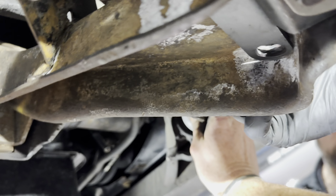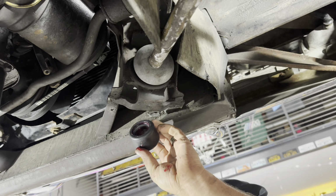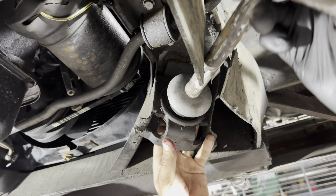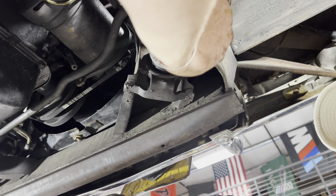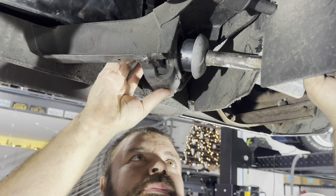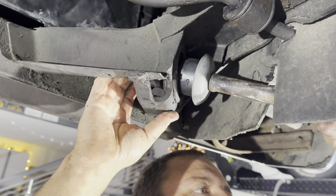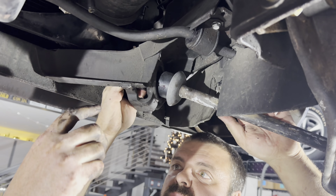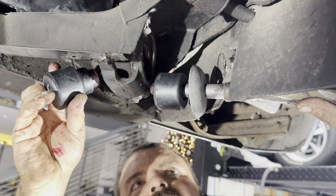This bushing is supposed to go through, right? It lines up, it just needs to get on there. This thing will pull it through? Yeah. Now this goes on here. It's straight though. You got to shove that through. Keep pushing, you got to push pretty hard. You've got to get the bushing through, and then get this on the end of it. Do we need a mallet or something? You do need to draw it. Should we use the nut and a big washer on this side and pull it through? We can actually flip this around too and try it that way, because sometimes that helps us locate.